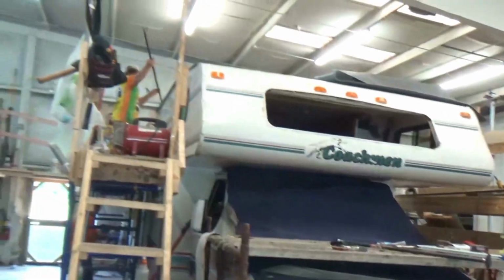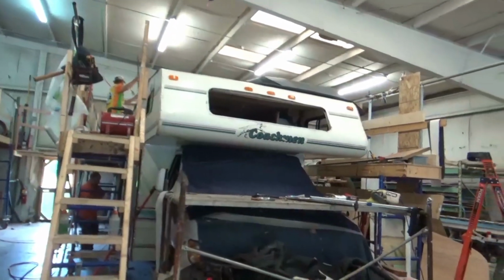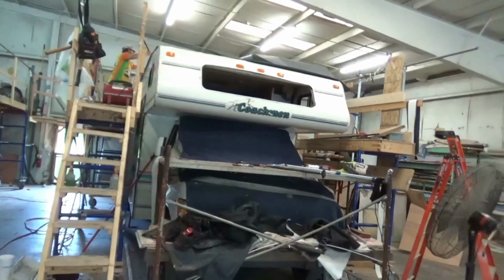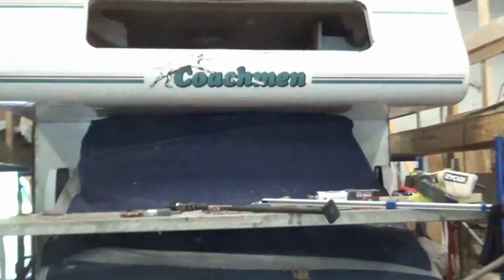We'll get it down. So right now, what they're doing is putting up all the glue and the adhesive. Then we'll wait for that to flash off. Pull the roofing over. Then we have that big heavy roller. We'll roll over it with that, and then the curbs go on, and we start welding and putting everything else back together. So we'll be back with our Coachman.